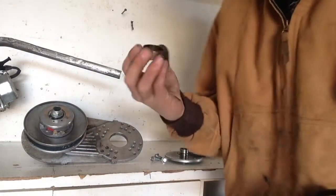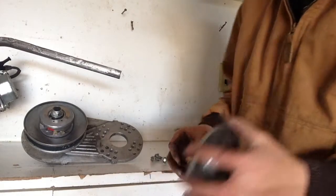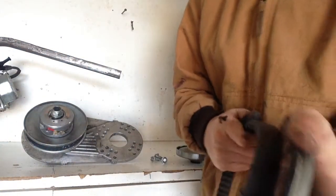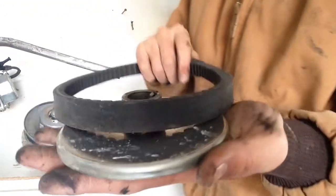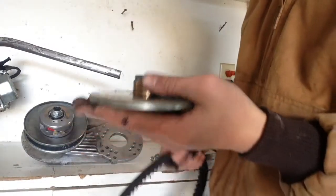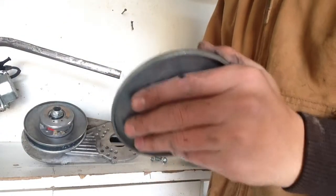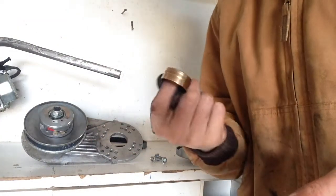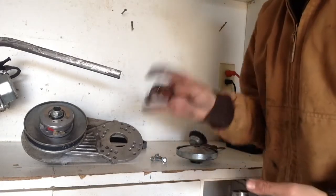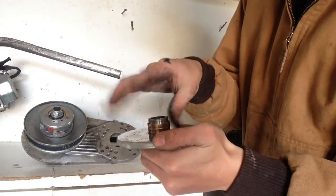Now you have this brass bushing that goes over top of the shaft on your engine, but in this case it's going to go over this just to keep your belt. So if you can imagine, your belt is going to be trying to grab if you don't have this little bushing on it. So if you have the bushing on, it's going to spin like that and it won't wear this little collar out as fast. I believe you can get these on Go Power Sports for like $2 — so if yours breaks or isn't in your kit, you can either send your kit back or just spend $2 and get this. So now we're going to take the bushing and slide it over — not too hard.